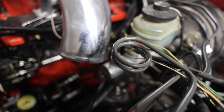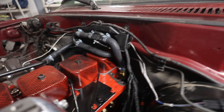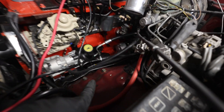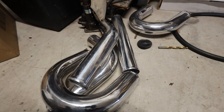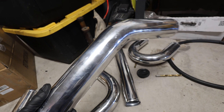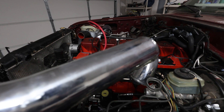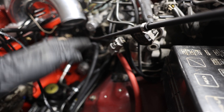The biggest issue I was looking at was this charge pipe contacting the brake master cylinder. I have the engine jacked up on the backside to simulate what it will be like when the transmission is in. We purchased a bead roller, so I'm not too concerned about cutting this and angling the pipe more down. What we need to do is find the right angle and cut through this part of the fender, which will allow us to connect the charge piping to the intake. The intercooler kit comes with a bunch of different pieces — there's a 180 here, but we'll probably use this 45-degree. We'll have to do some cutting and re-roll the beads, and we can trim this so that we have enough room for the angle.